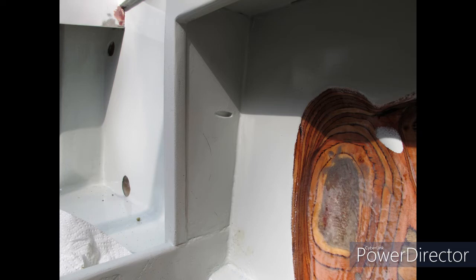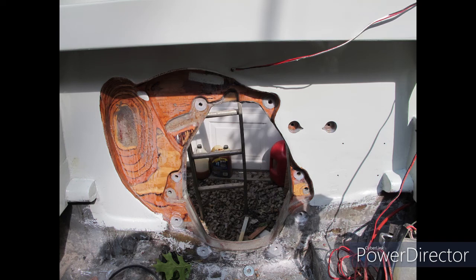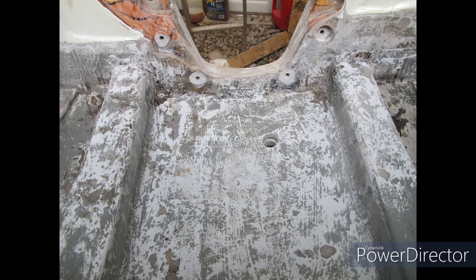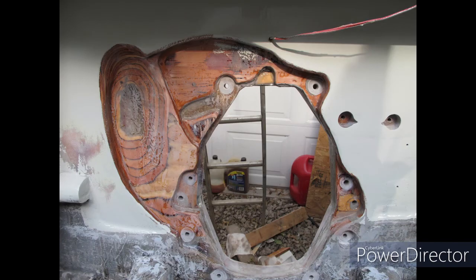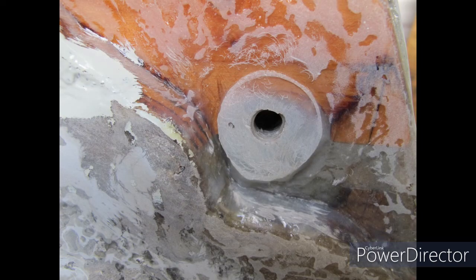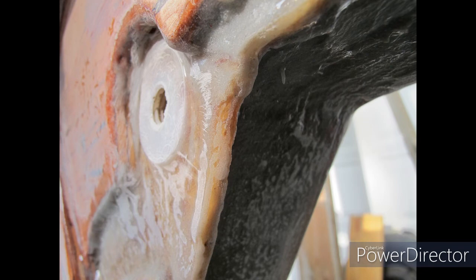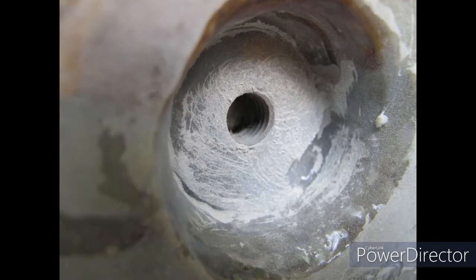There's the scupper — already fiberglassed, smoothed out, and everything. You can see where the fiberglass has been applied on the lip around the engine box, which water comes in and drains around. The inside of the transom is just about done. But if you remember, the transom has a V in it, so if I put a bolt from the inside to the outside, there's no way a washer's going to fit flush on both surfaces. So I had to angle the interior portion of the transom with some thickened epoxy — just epoxy, fumed silica, and some micro balloons — so that when I put a bolt on there, the washer fits flush and I can get even clamping pressure.